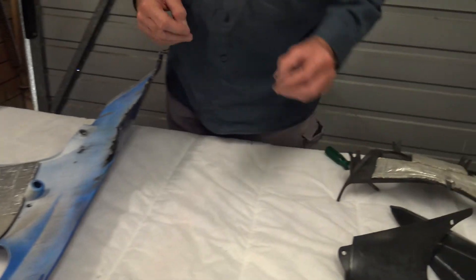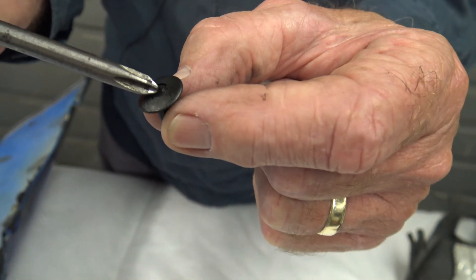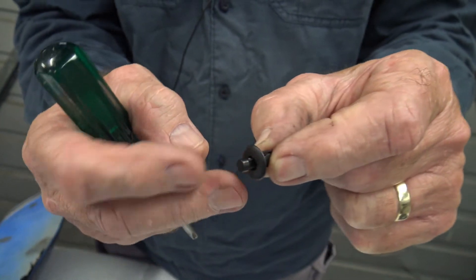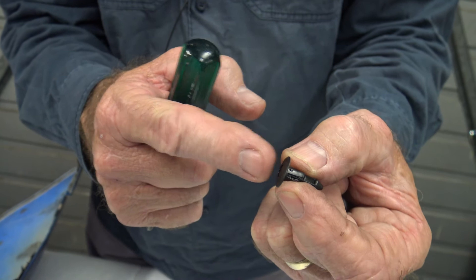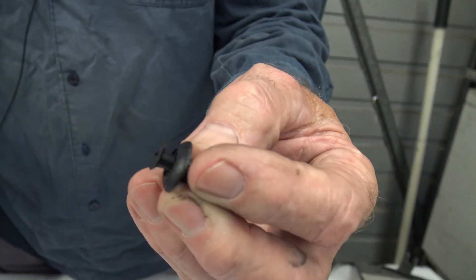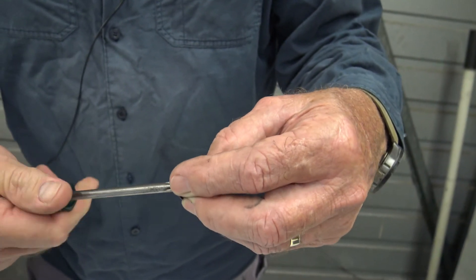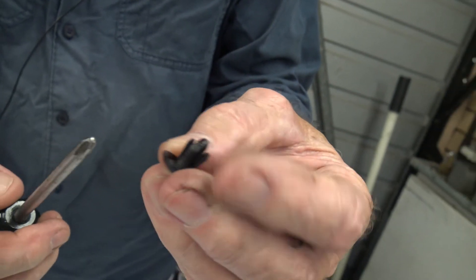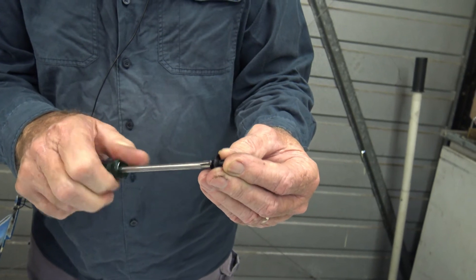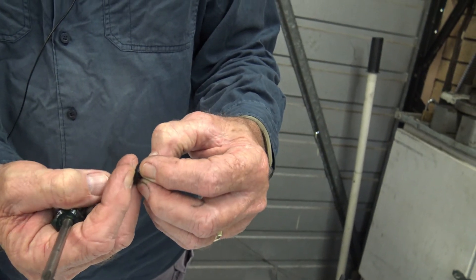When you have panel clips there are two basic types. There's this one here which just has a center pin — to undo it you just push in the center pin and it will pull out. To reinsert it, you push that pin all the way down, reinsert it, and then push it in and that locks it in place. The other style you'll see looks like a Phillips head screw, and that's exactly what it is. Put your Phillips head screwdriver in, you screw that in, that expands the other side to hold the panel in place, and you obviously undo it to remove it. And sometimes they lock up, so just put a little pry tool under there and reef it out.